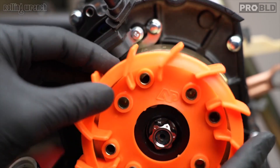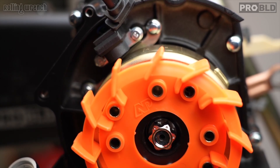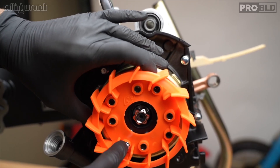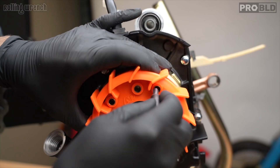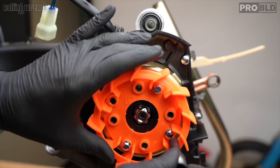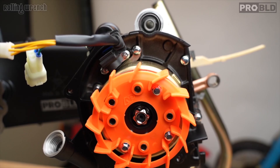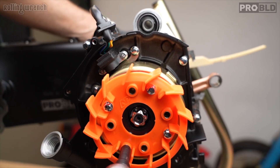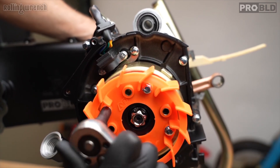Last step is lining up our fan — the holes are on the outside. Put a little Loctite on there. A little trick of the trade: keep all the bolts loose so you can get everything started first, then crank them down. Make sure the screw isn't too long — you'll know right away because it'll touch your stator and you'll feel the grinding. I've seen that happen so many times. On the other side grab the variator so you can tighten these suckers down nice and snug.